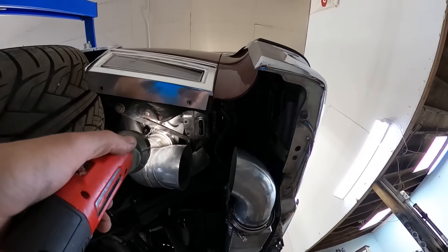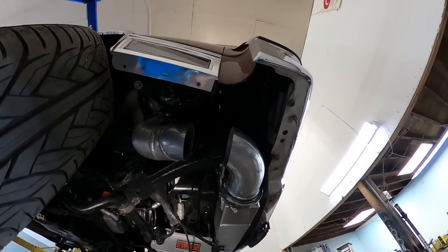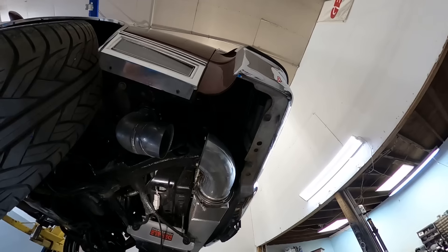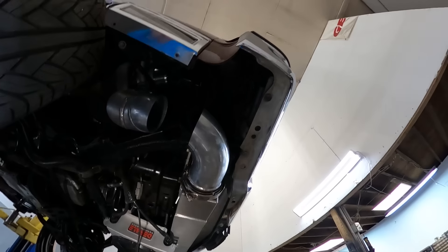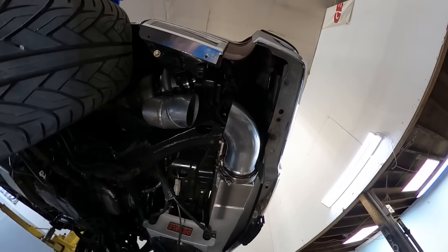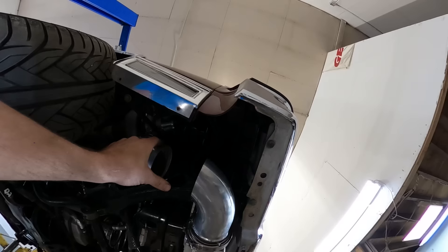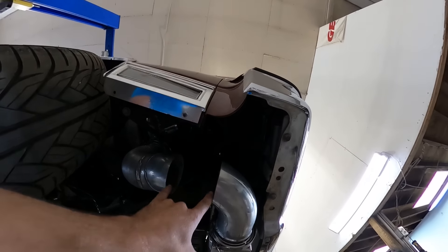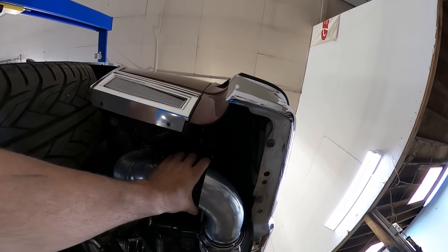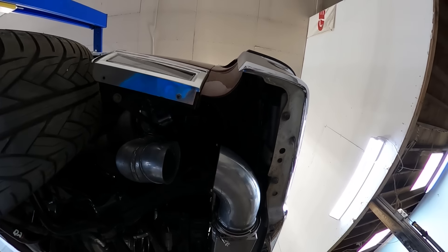The turbo orientation was just a little bit different than the old one. So what I did was took a spot where I thought would work best. There were two welds in this area right here, so what I did was just cut both of them out pretty straight-ish. Now I'm going to make a piece that fits right in here, get it TIG welded up, and then the cold side's done.